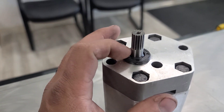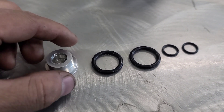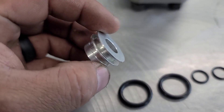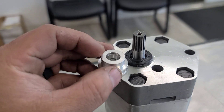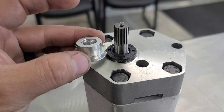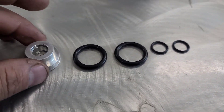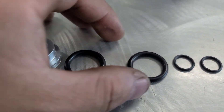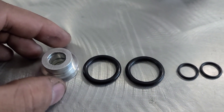This is actually a great seal, but a lot of times a lot of people do like to upgrade, and this is the super seal right here. The super seal is a fully machined aluminum shaft seal of this same version. You guys can kind of see it does take O-rings, so it is fully rebuildable. You guys could blow through these down the road and still rebuild them, and we do offer those on the website as well.